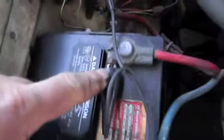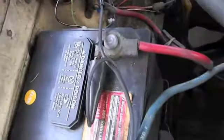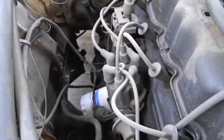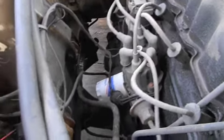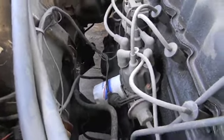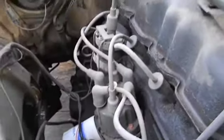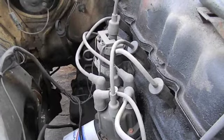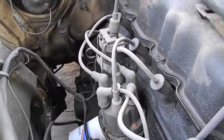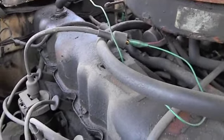We've got the crank button hooked up. I hooked it to the positive battery terminal — I could have gone to the solenoid, which you could do on your car too, Ruben, but the solenoid's on the starter. I disconnected and grounded the coil. The ignition's off so I shouldn't be getting anything out of that coil, but on some cars when you energize the solenoid you will get power up to the coil and the car could fire. With points and electronic ignition, if you backfeed it there's about a 70% chance you'll pop the module — putting 20, 30, 40, even 50,000 volts right to the module.